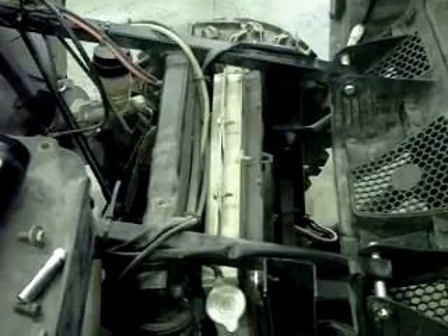We'll turn the time over to Caleb so he can explain the install. Go ahead and move those bolts. I'm going ahead and unhooking the rubber hose down there at the bottom to make this a little quicker. Just take the oil cooler — you've got the zip ties cut away from the lines. It sets right on here. The frames are notched, which gives you a place to drill your holes. Go ahead and drill with a quarter-inch drill bit, put the bolts in that are supplied, and bolt it down.